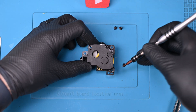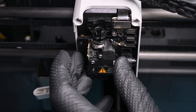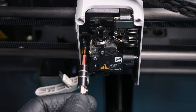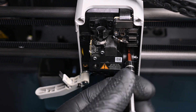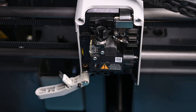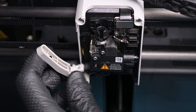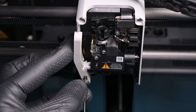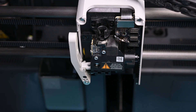After that it's just four screws. The extruder can now be installed back into the tool head. The screws can be tightened in any order — I'll start from the top and work my way down to the one on the right before the last one goes in by the cutting arm. Our cutting blade can now be pushed back into place. The spring may feel like it's stuck, but a little extra nudge will get the arm closed. While holding tension on the arm, I'll tighten the smaller set screw and the extruder assembly is fully reassembled.